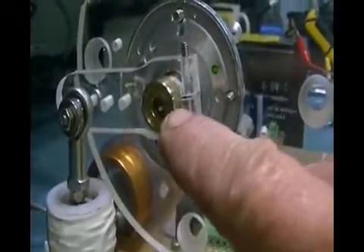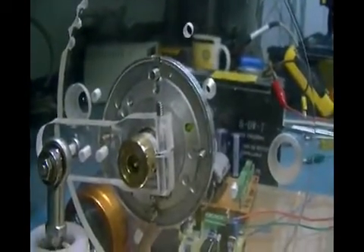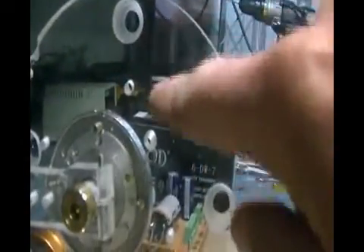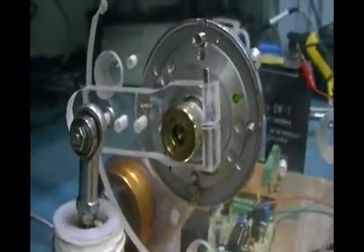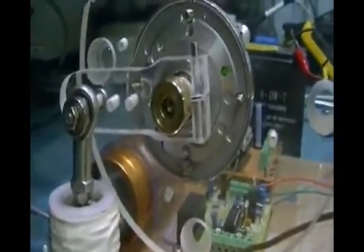With the piston and conrod pushing on the crank at 90 degrees, we get full power and convert it into rotational energy. In a normal IC engine, when gases are compressed and the piston is at top dead center, it sends all its energy straight down without turning the crank. As the crank turns, the energy in the cylinder decreases — so we wanted to deliver all that energy when the crankshaft is at 90 degrees out.